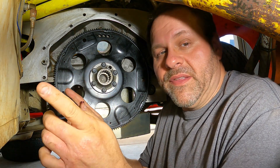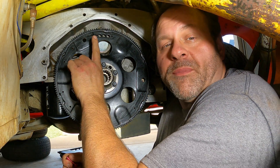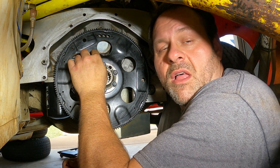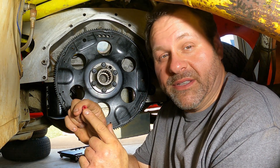That pumps through the lifters, up the push rods, and out into the heads. So if we restrict it right here, we're restricting how much oil ultimately goes up the channel, down along the cam, through the solid lifter in our case, out the push rod, and over into the head — that's how it's getting there. So we're going to choke that down with that hole right there is how we're going to do it.